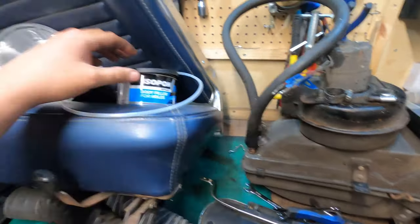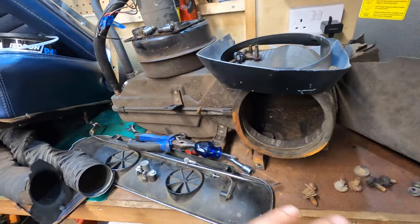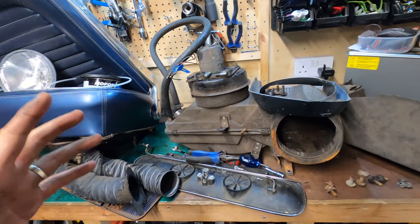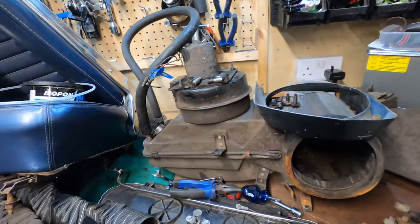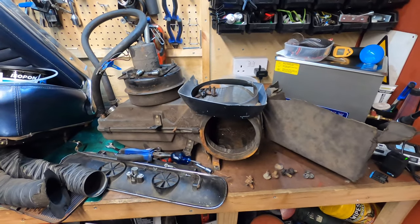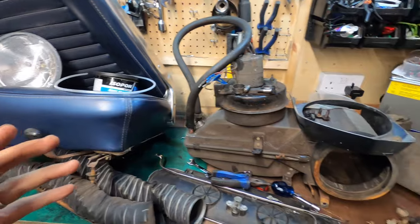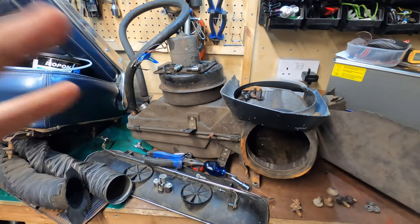Pinholes will be filled using some strong fiberglass filler. Some new gaskets, put everything back together. That would work. That would be 100% waterproof. However, I do know in 10 years time, it's probably gonna rust through further up the cowl and cause future problems. On the other side, it will cost thousands and thousands of pounds, I believe, to pay someone to do this work. This would be very, very cheap and it would be a short-term fix, but it would allow us to progress with the build.